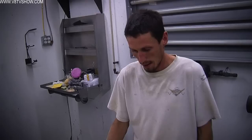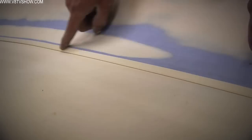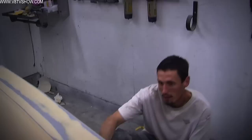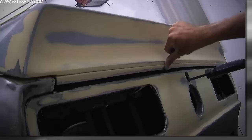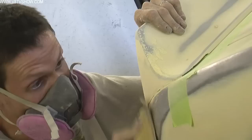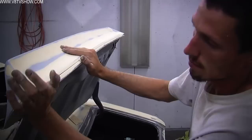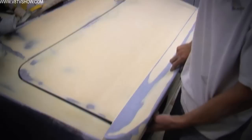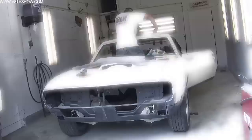On our 68 Camaro project I had an original RS wing that had some things we just didn't like — they all stand up and have these little gap bumps on the front and back side. So I did a little bit of fiberglass work and moved some of the lines around just to make it fit a little nicer. We got rid of the little radius section, gave it a nice little bevel, and tapered the ends. On the back, the original body line was a quarter inch higher and had little stand-ups — I fiberglassed it in then moved my body line a quarter inch down so everything flows nice and even. The side profiles on the wing were standing up a lot taller, so I had to cut them down and file them quite a bit to match the flow of the quarter panel. On the inside I set them up nice and smooth, and I'll set a piece of foam pad right here just like a lot of the original cars did, so it'll come down and sit nicely on the quarter without squishing it. Now all of our gaps are nice and tight all the way around — just a little bit of trim work to clean up a few corners and it's all done.